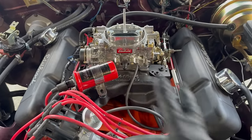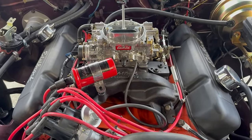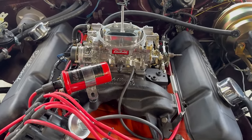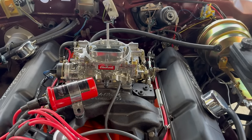With that done, I was able to lean out the idle mixture again. Another quarter turn or so seems to be about right. They're now only about 3/4 to 1 turn out. That's kind of low, but I was able to tune it, so I'm gonna call that a win.